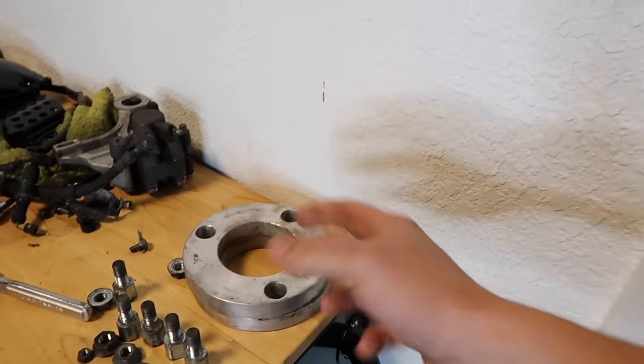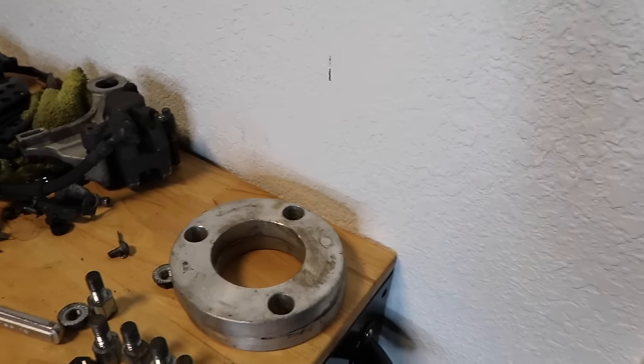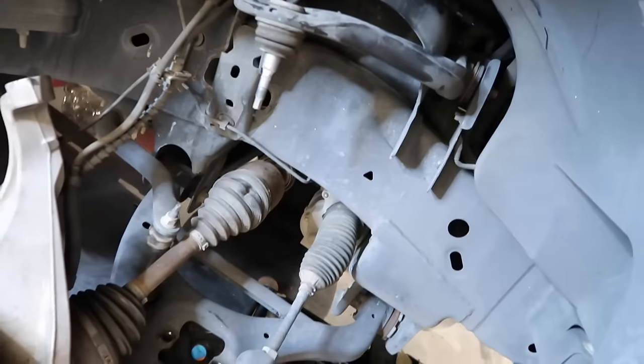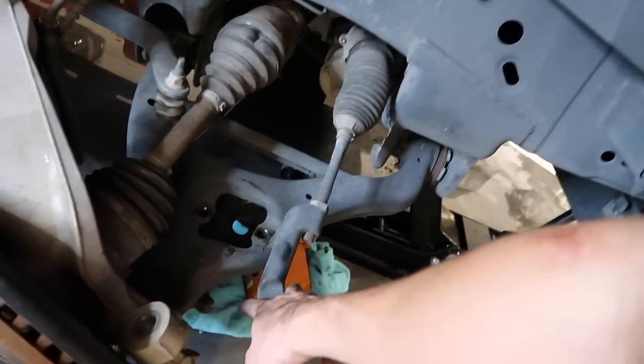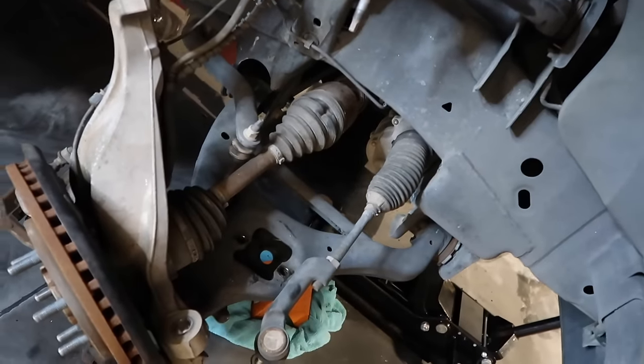You can watch me put the whole lift together with those in it, but I ended up taking it all back apart off camera. To get the strut out you pretty much need to disconnect your upper ball joint, tie rod, and sway bar. I also took the caliper off for some reason.